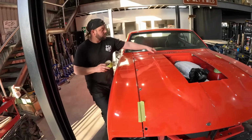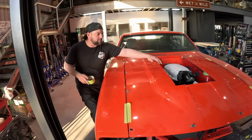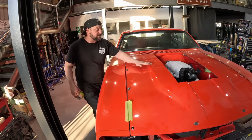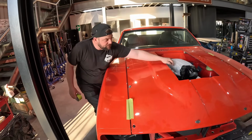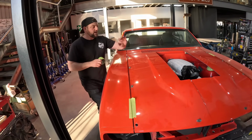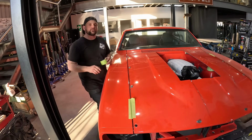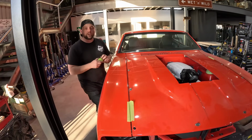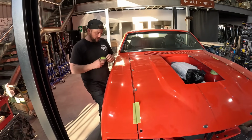We're going to be jumping on to the bonnet in the morning. Going to be cutting some holes in the bonnet, so we'll get straight after that first thing. What we're going to do is, this is a bit of a luxury, you don't usually get this. So this had a big supercharger in it, and this is how they took it on and off. But we are going to use this as a template to bring some cardboard over to it and make the template that we need for our steel bonnet. So after we do this, we'll lay this template onto the steel bonnet, and then we'll be able to cut the hole to go over the engine and hopefully have a nice neat hole for the bonnet.